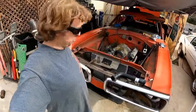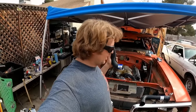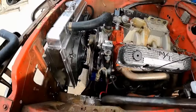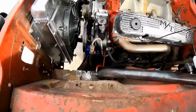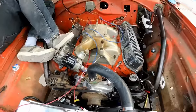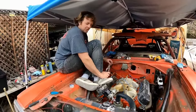So even though we've got this badass radiator from Cold Case, which is actually pretty good, one problem, it's for a small block. And I didn't even catch it until we were going to put it in the car. So we're actually having to take some extra hoses, cut them and shape them to slinky dink it from one side to the other, so then it will attach to the water pump. Because the water neck is way over there, and it needed to be right here.